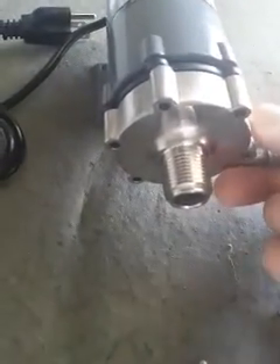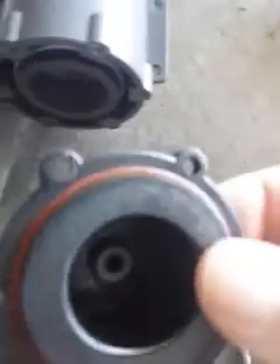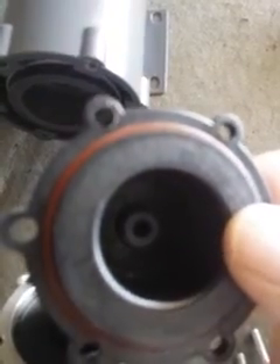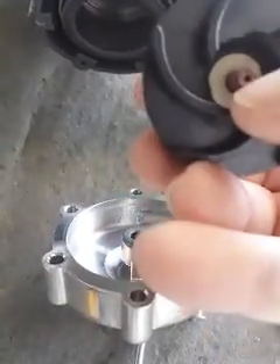Now the head is mechanically separated from the motor by a magnet, and the magnet is inside and is part of the impeller. So there are two points that can bind up your pump. You can see inside of there — that's one of the pivot points. And then if you take the impeller out, it has another pivot that goes into this pivot hole.